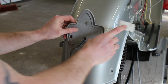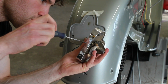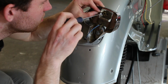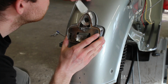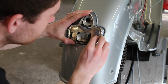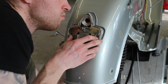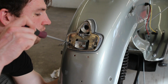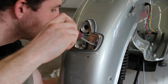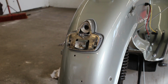And the rear light, let's see: the blue cable goes to the brake light, and the black cable goes to the rear light. The M5 screws should hold the rear light case in position, and I'm using the original wing nuts from the inside.